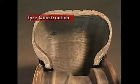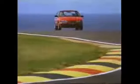This section examines tire construction. A tire provides a cushion between the vehicle and the road to reduce the transmission of road shocks. The air in the tire supports the vehicle's mass and the tread provides frictional contact with the road surface so the vehicle can maneuver for normal use.